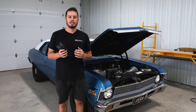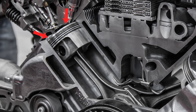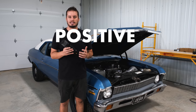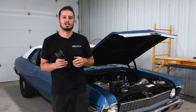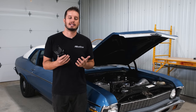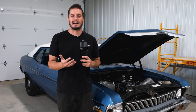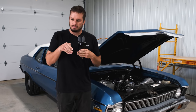If you aren't familiar with an engine, there's basically a couple dynamics working. There's the top end of the engine, the pressure on top of the piston, and then there's below the piston — everything beneath the piston inside the crankcase, where your oil is. There's a term called PCV — positive crankcase ventilation. It's a must-have for any internal combustion engine. Basically, when a piston moves up and down inside the bore, it's creating a force, moving air around, and creating a positive air force. What happens is oil stability is sacrificed — as you create pressure, oil is going to move to places where it shouldn't be.